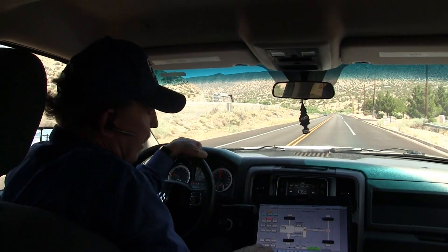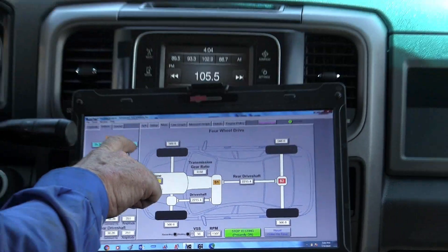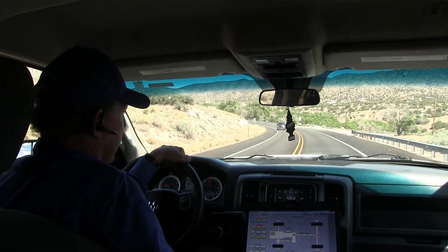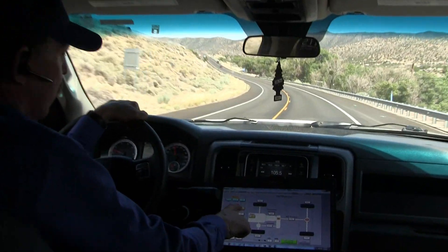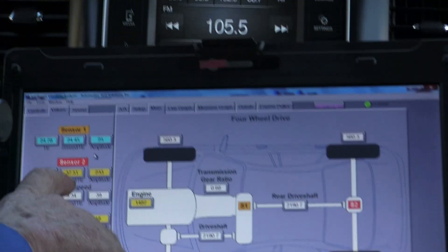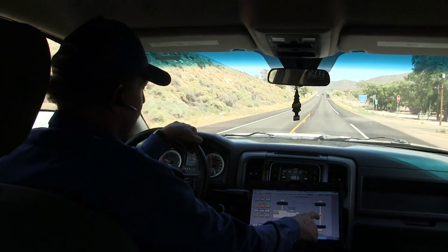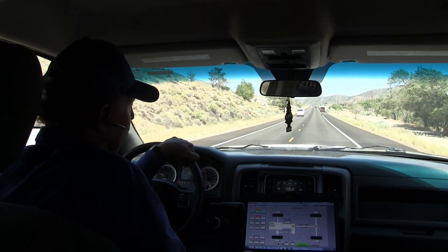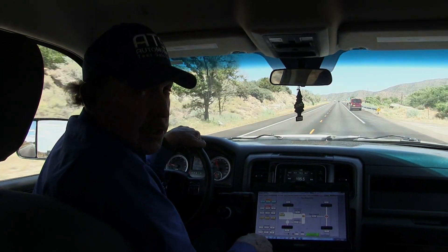Okay, we're on the road. We can see the rear shaft is doing 100, 200, where the front is only 21. It's 223 on the rear. So this problem is on the rear of the housing. Do you see how the rear is 226 and the front is only 14? So the rear is the problem. Whatever is going on, it's in the rear — whether it's in the differential or whether it's a u-joint, it's back here. So we need to go back to the shop and check this vehicle.